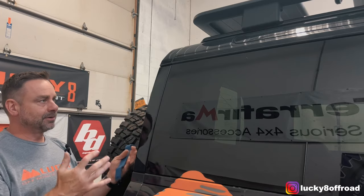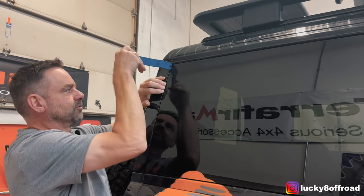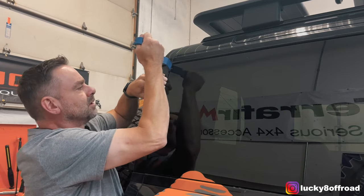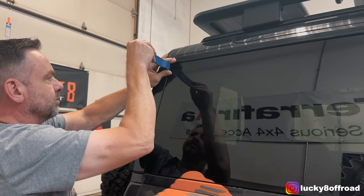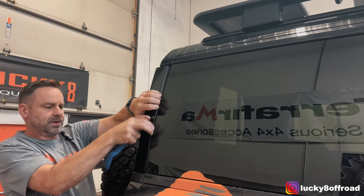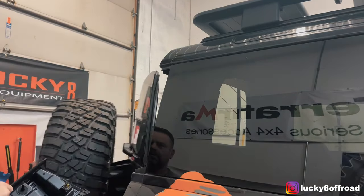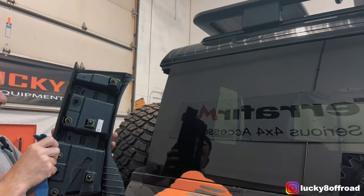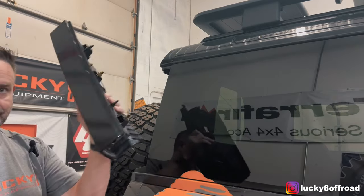You might be able to get your fingers in there and do it. I recommend starting at the top — everybody's got a set of plastic trim tools. Just tap it like that and it will release that upper clip. Once that upper clip is free, wiggle your fingers back there and pull it out on the passenger side. I open the door and it makes it even easier. That's all you got to do to get that out.